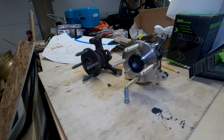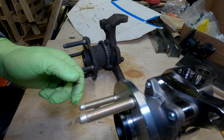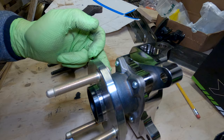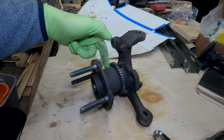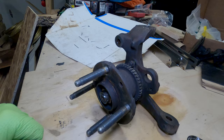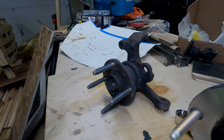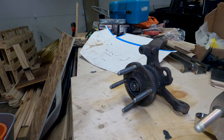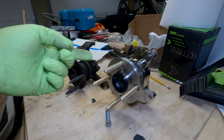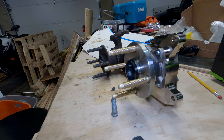Contrast that to these MR2 hubs — there's a really beefy flange with a lot more material, so they're more robust. They're also a sealed bearing assembly, which tends to provide better longevity. The factory Miata units can be problematic: you have to take them apart and repack them with higher-quality lube to hold up to track abuse, and they still wear out fast. A lot of Spec Miata people deal with this by getting Mazdaspeed Motorsport units or repacking them. Based on the design differences, I anticipate the Kiesler hubs will last longer and have a longer service life.